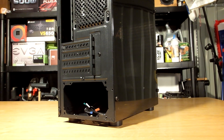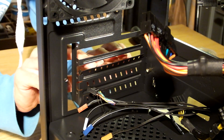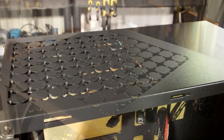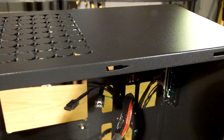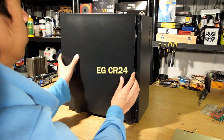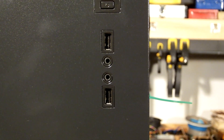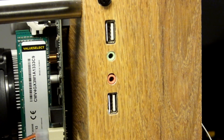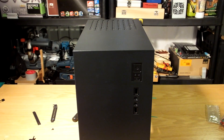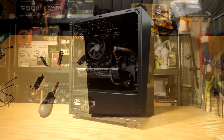The building process also reveals the cheap nature of this case. For example, there's only one actual PCI slot cover — the rest are stamp-outs that you bend off to remove. The top fan vent seems to have more steel than holes, and despite the acrylic panel tint, visible cutouts are telltale signs this case is generic, sharing the same base as the EG-CR24, Sigma-Tec Scorpio, and CIT-7. The front has two USB 2.0 ports with headphone and mic jack, plus plasticky power and reset switches with LEDs. It's built on 0.8mm sheet steel — pretty tinny if you've built on better quality — but these are nitpicks since cheap cases employ the same cost-cutting measures.